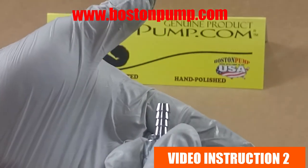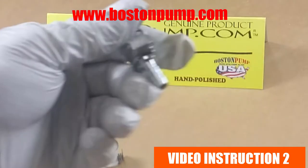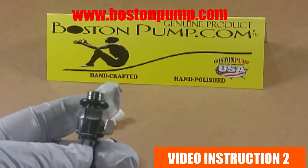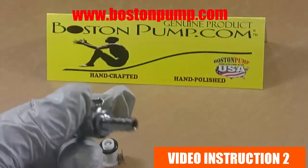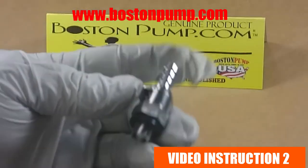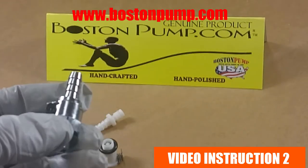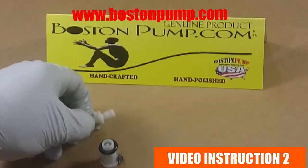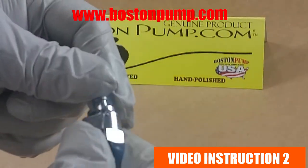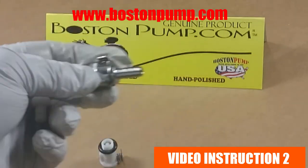You can hear it click, and you can kick it up — it pops right back. These parts are sold as OEM replacement products on our website at bostonpump.com. On the left-hand side of the page under the accessories category, they can be purchased individually or as a set. We do not recommend mixing and matching metal couplings with plastic ones. If you upgrade to the metal ones, you have to upgrade both, because mixing them will result in a poor, wobbly vacuum connection.